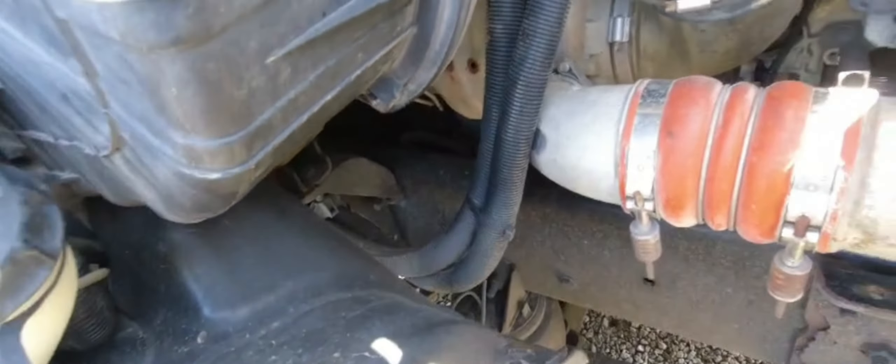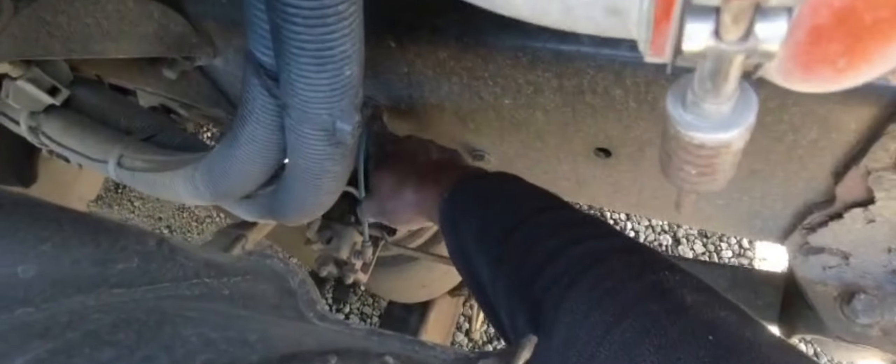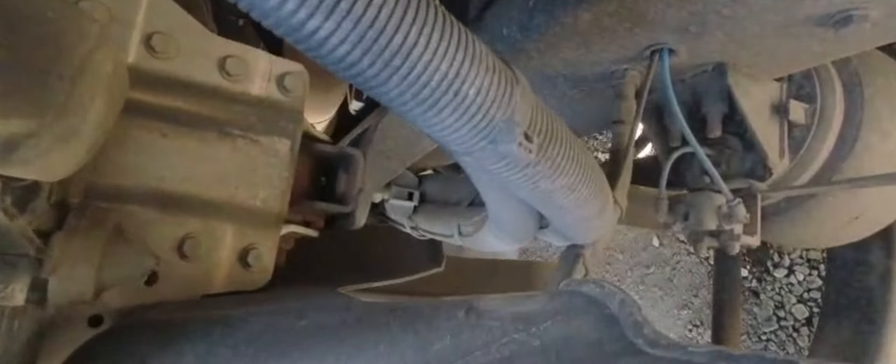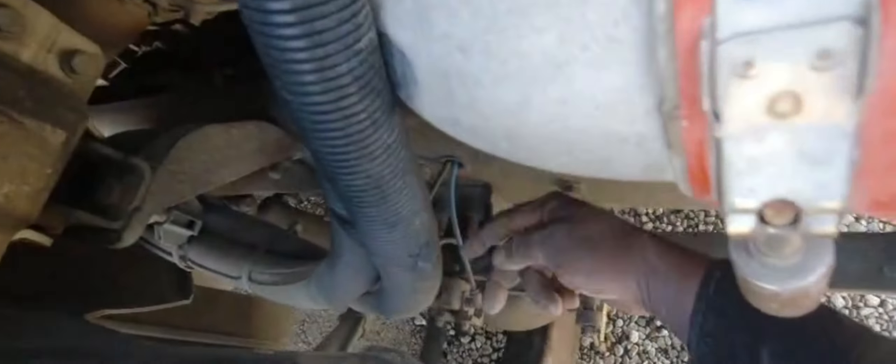Another thing I have to do is run my wires away from the turbo — this part gets very hot. I'm going to run it behind the engine bay, come down this way, and across to where the ABS sensor comes across, then go in there. That's going to be my routing — behind the HVAC box, out on the other side past the heat shield, then run it across and zip-tie it coming down.